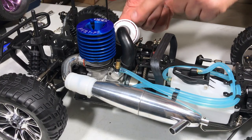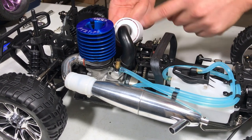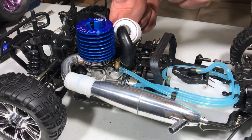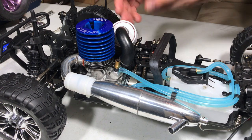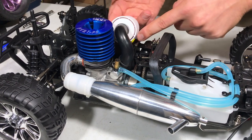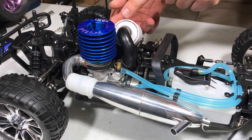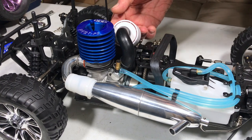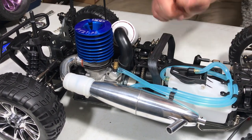This air filter is what's known as a breather-style air filter. So what happens is, this is mostly just a plastic cover on the filter. On the outside here is where the air enters the filter. In case you wind up driving through water, and water does make its way into the filter, well, the lowest point will be at the bottom here. The filter will most likely not suck water into the nitro motor, which I already have a lot of experience with on my own OS18TZ Revo.